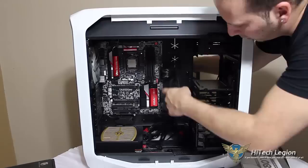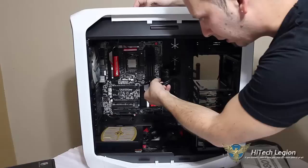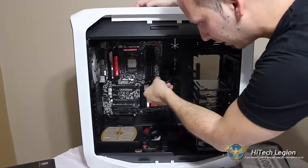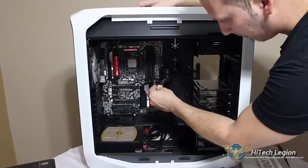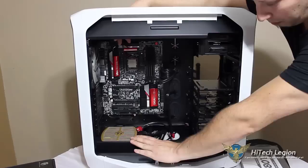We have our front panel connectors here — we'll go ahead and get those plugged in. With the openness of the case it just makes everything very easy to work on, very easy to route back through our grommets. We have our USB 3.0 connector. We're going to go ahead and plug in our 24-pin cable to the motherboard first. With our 24-pin plugged in, we have our USB 3.0 header right here and our USB 3.0 cable that runs to the front of our case — we can very easily mount that through here, plug it in, and it goes right through the grommet there. My cable for my graphics card is run from the power supply, and my 24-pin and my 8-pin. My cable length was 600mm — I was able to route it behind the motherboard, throughout the cutout at the top of the case very easily, and plug it into both locations.